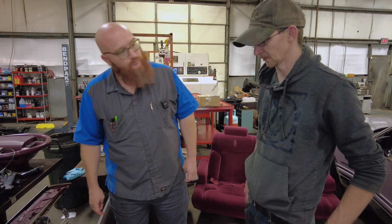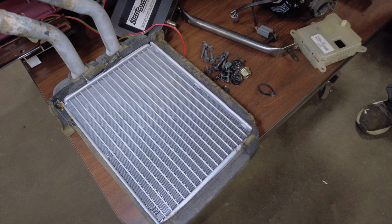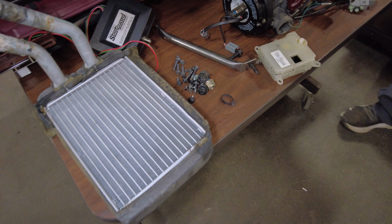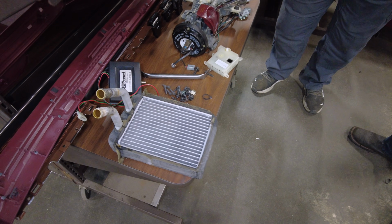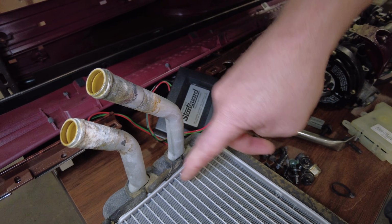And this is actually a common enough issue on this chassis and this era of Fords that you can still buy the brand new OEM Motorcraft actuator. And then we have the actual heater core, which only a fool wouldn't change out when we have all this apart. Because as soon as we do the job, if we didn't change that too, 3 weeks later, you'd have a heater core leak. Yeah, having to pull the HVAC box out and having all that access to the heater core, it was 4 screws and pull the heater core out to replace it. There's no sense in not doing it. Yeah, and you can see corrosion there on the outside. It's like chalk, which means it's very likely on the inside as well.